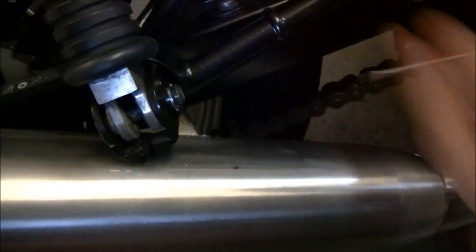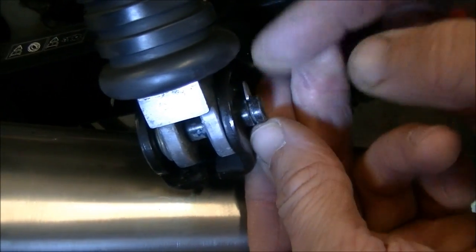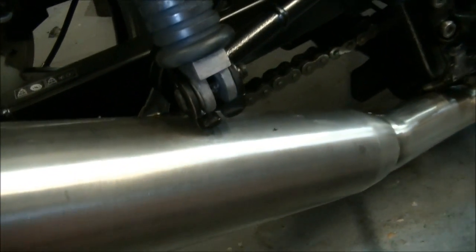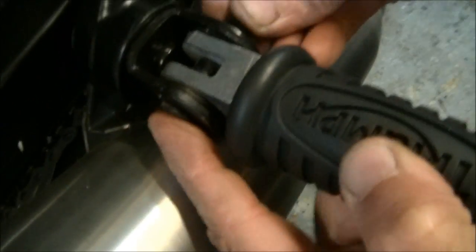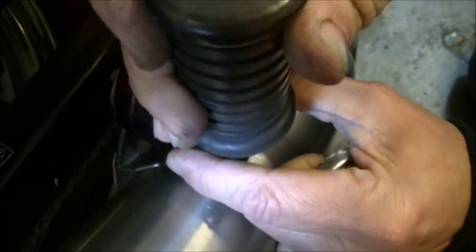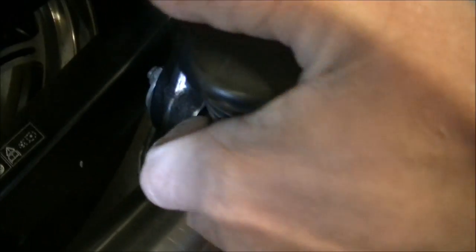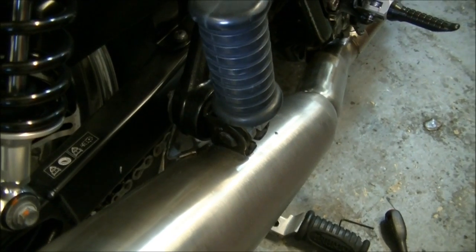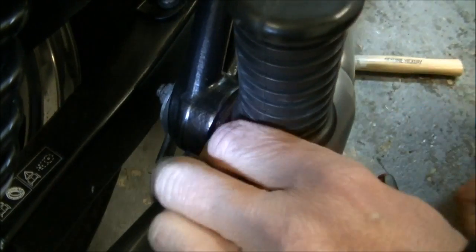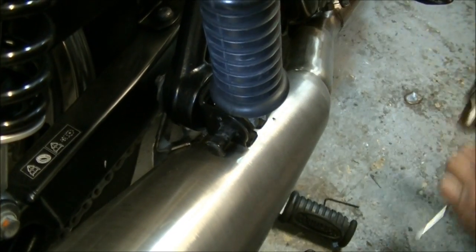Right, same on the rear. Push it upwards to start with. Screwdriver in that hook and just lever that clip out of the way. Now I'd suggest getting a magnet for this, just to catch hold of the ball bearing which lives in there. The spring is at the back, the ball bearing is in the front. Once that's up out of the way, just give that a little tap — it might need to drift out very slightly. Careful of the exhaust.